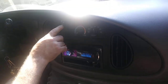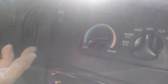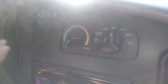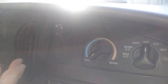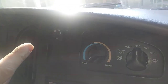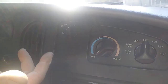Here's an indicator that the switch is bad and not the blower motor resistor. They have a blower motor resistor — it's behind the battery and underneath the blower motor. It's a thing with a bunch of coils on it. That can go bad too. That controls your speed: low, medium, and high.